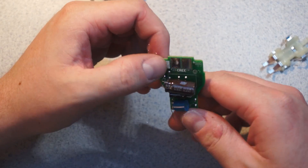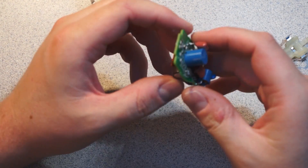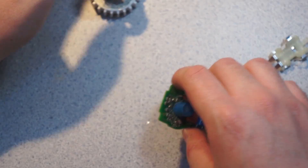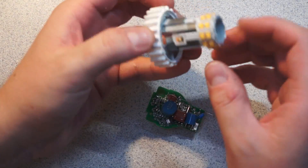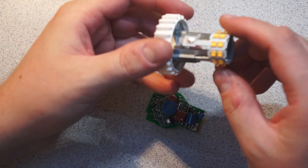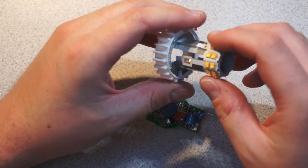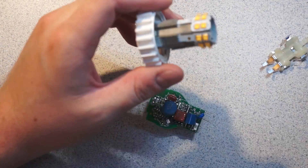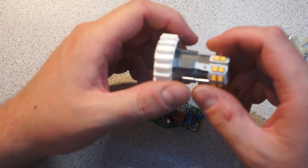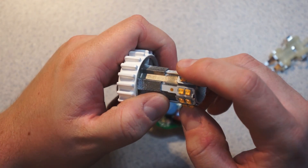There is just squat there, isn't there? So this is obviously a straight offline switcher - there is no isolation here. But I think they're probably relying on the fact that they've got a metal core PCB here, so they've probably got much better isolation than some of the other solutions. Though actually the Philips LED bulb seems to have pretty good isolation just based on the construction as well.